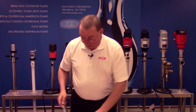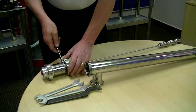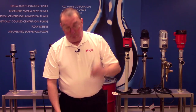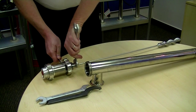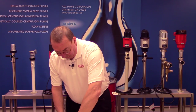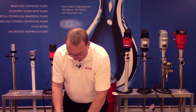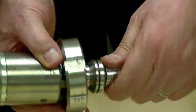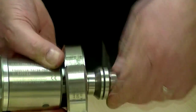Take your 15 millimeter wrench. There's an open gap in the top just above the nut. Take a 20 millimeter wrench, put it on the flat parts of the shaft, and loosen it up — push it away from you. Once it's loose, unscrew the shaft. Be careful because the mechanical seal is spring loaded.